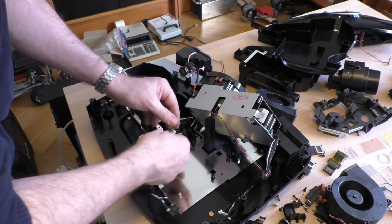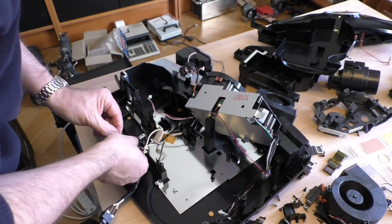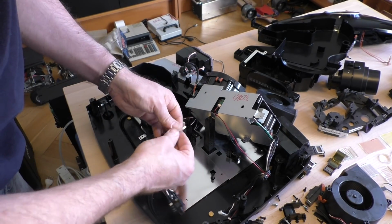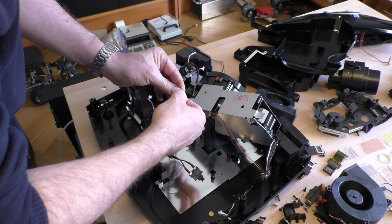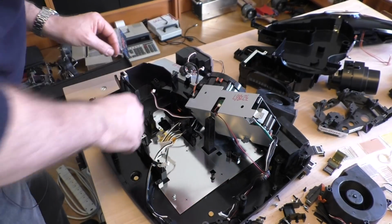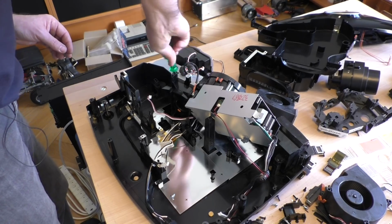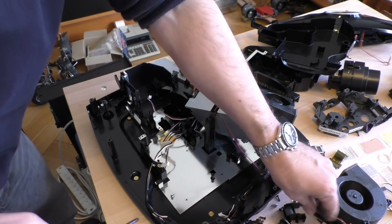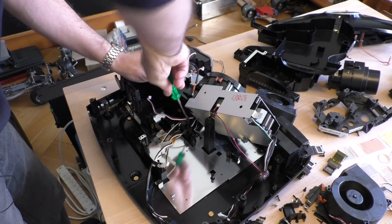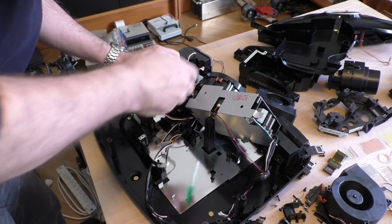And there's a thermal fuse. It looks like in series to the switch. No, maybe separate wires. That shuts off at 110 centigrade. Okay, that's pretty hot for electronics. So in case your projector overheats because someone put the rack over the top or something like that, it will automatically shut off.